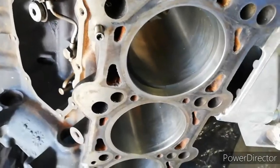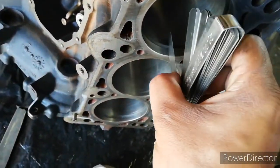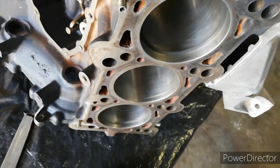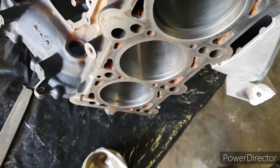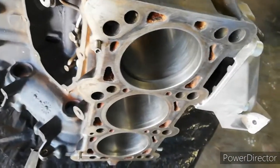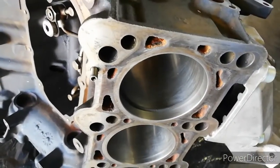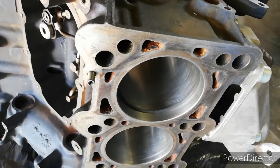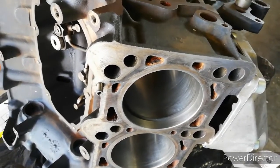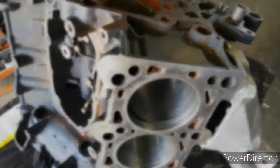I've just filed the ring down and I'm able to put the feeler gauge with 0.381 millimeter into the ring gap, which is slightly bigger than we need it. But because I'm going to at some stage be running higher boost on this motor, I'd rather have a slightly bigger gap on this ring for security reasons. Now that we're done with the gapping of the ring, I can put the ring onto the piston, and once we get the crank bolts we'll be able to put the crank in and then put the conrods into the motor.